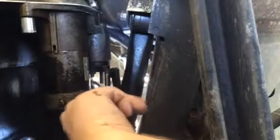Okay, I'm going to disconnect everything, and then I'll go from there. I'm going to try to get you a shot in here. The first one I'm doing is taking off this little hot wire. This operates the solenoid so that the poles connect, and that turns the starter motor. You have to disconnect your hots first, so the starter isn't hanging on your wires and getting you all jammed up. Don't lose your little bolts.